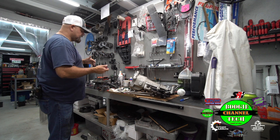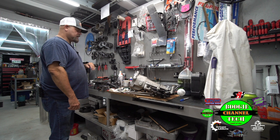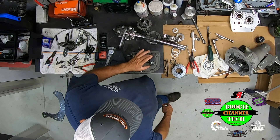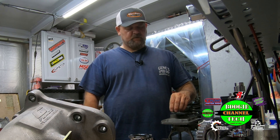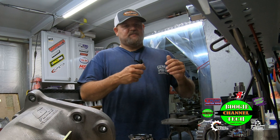When I was taking the transmission apart this time to check things, I noticed something I've not looked at — and I've already had my ass kicked for not looking at it — and that is the shifter fork arm that operates the cam. It was worn out. I'm gonna show you: if you ever have a problem with a G-Force 101A not wanting to go into gear, or a 101, go back and look at these. It never dawned on me to look at this.